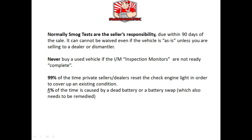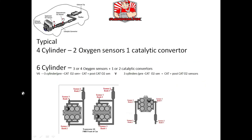One percent of the time unready monitors are caused by a weak or faulty battery. If this is the case, you still have to find out why that battery is dying — you could have a potential short or a bad alternator. When there's a bad battery, all kinds of issues can happen, from smog emissions monitors not getting ready to transmissions acting up.